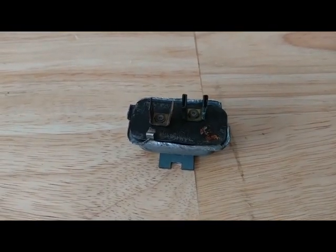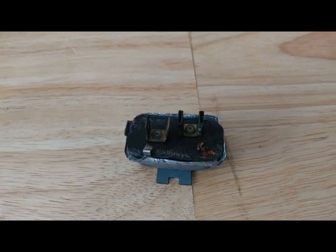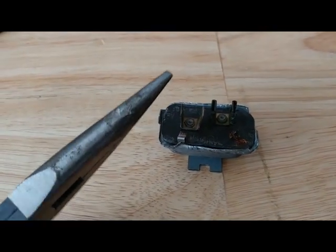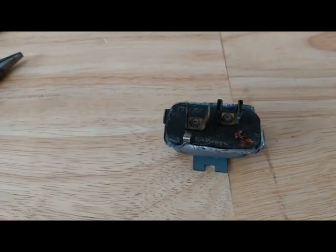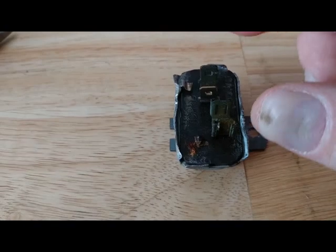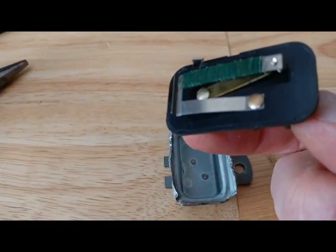The regulator showed up in this little metallic can, and in order to get it out, I had to pry off these little tabs all the way around the outside, which was a huge pain in the neck. Mostly I used needle nose pliers to get the very start of the can pulled apart, and then I came in with the big alignment pliers and used this to roll the rest of the tab over. Once I did that, I could take this entire assembly out, and then you can see the inside.